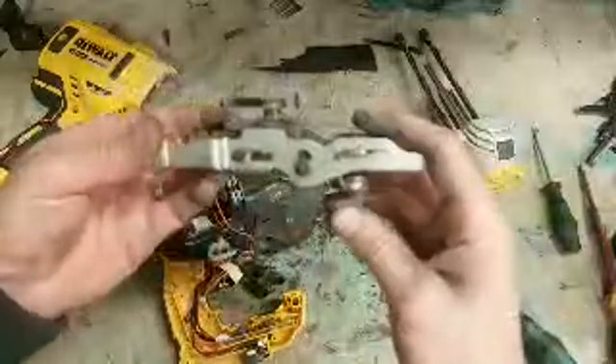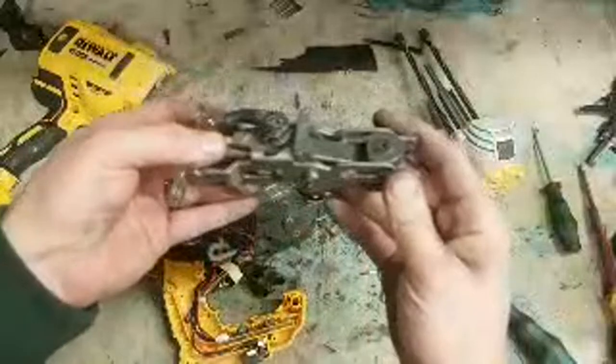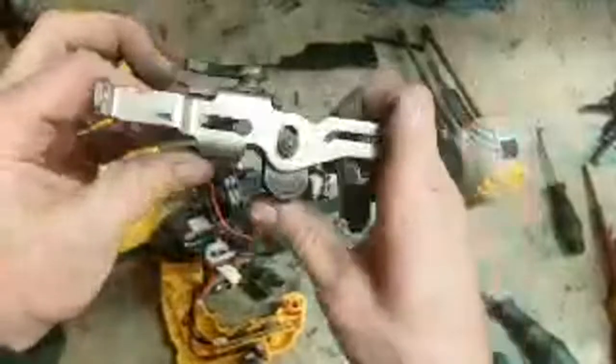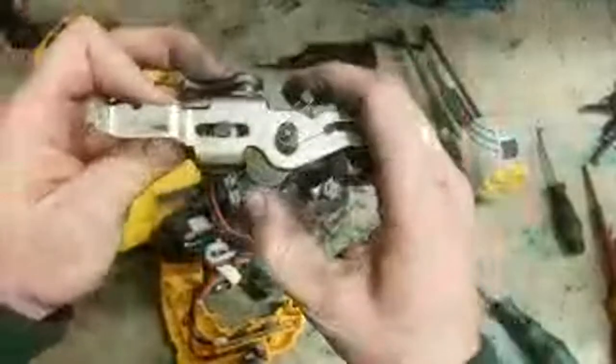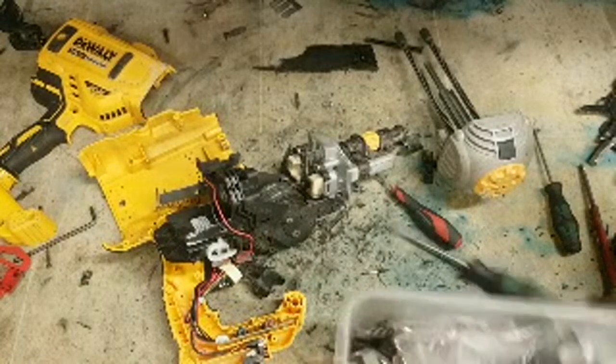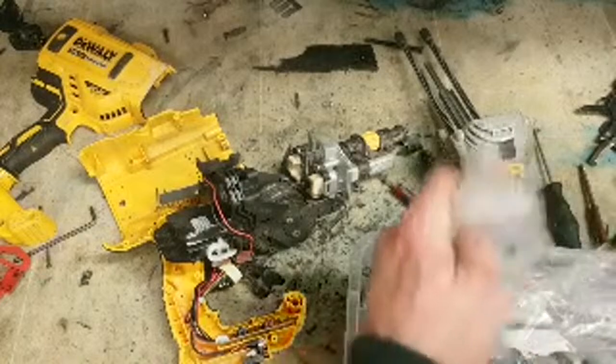Pull that solenoid out, pull the spring out, that's your axis. So whenever that solenoid fires, she pulls this back and drops down this roller. It forces that roller down, and that's what gives traction on your pin for your flywheel. But something on them eventually wears and they just start to lose pressure.